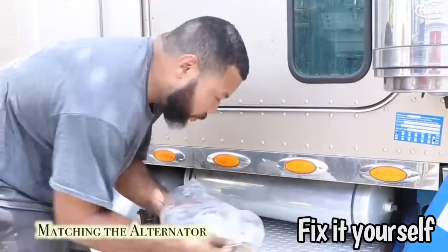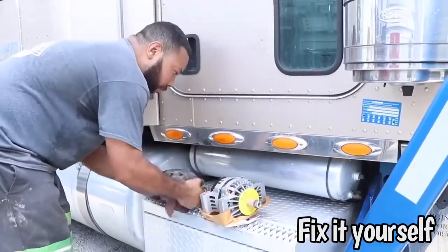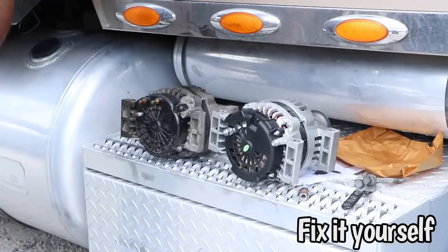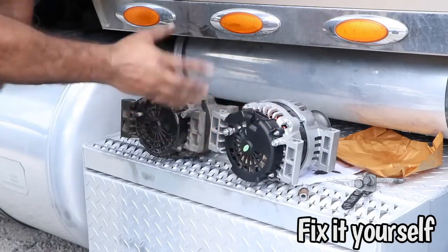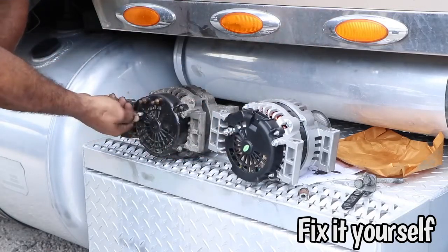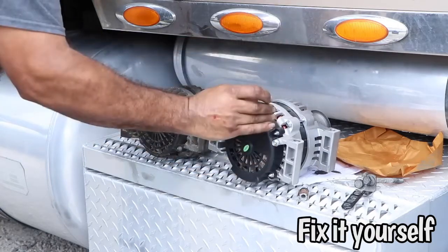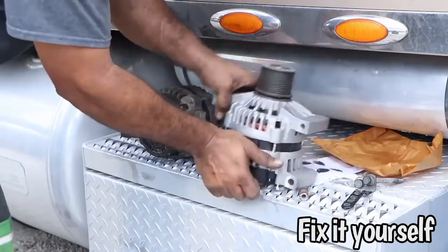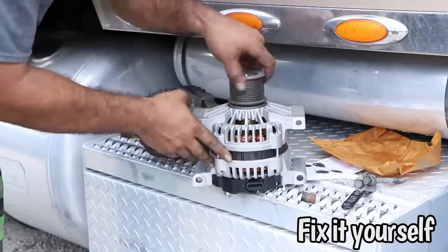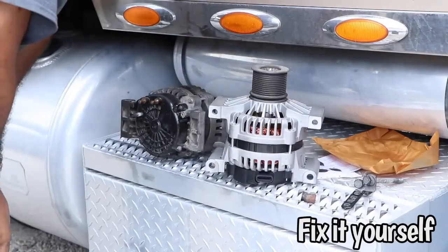There you go, folks. Now the next thing we want to do is make sure that our alternators have a perfect match. Okay, that fits — that's the same. I ran across one quick problem: when I saw this, I got afraid. But then I realized, okay, this is not the original alternator — it's a universal alternator that can be used to replace this alternator. This is the universal part. This is where I took the hot wire from, put the hot wire here. This is where I took the ground wire. Other trucks might have a plug-in; they don't use this screw — it plugs right in. So I had to take it into the machine shop, because I had to use a machine to take the pulley off the old one and put it on this one, since it didn't come with it. I had to use an impact gun to get it put on. So let's get this thing installed.